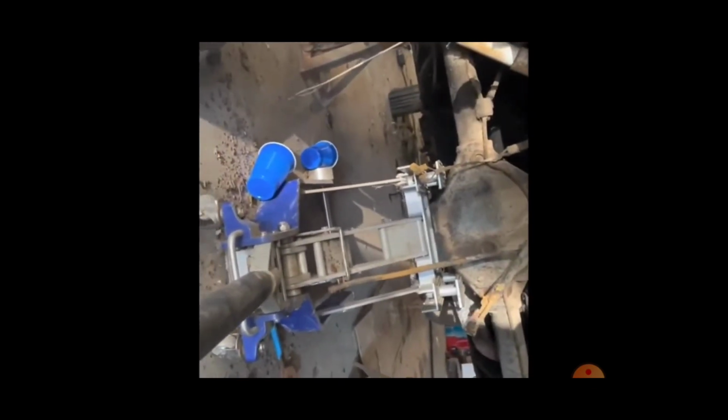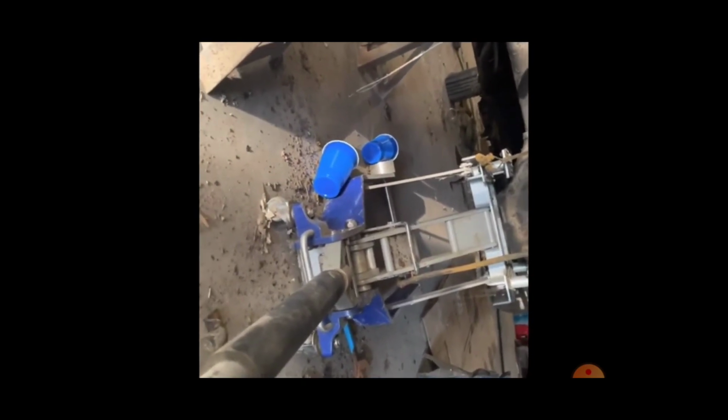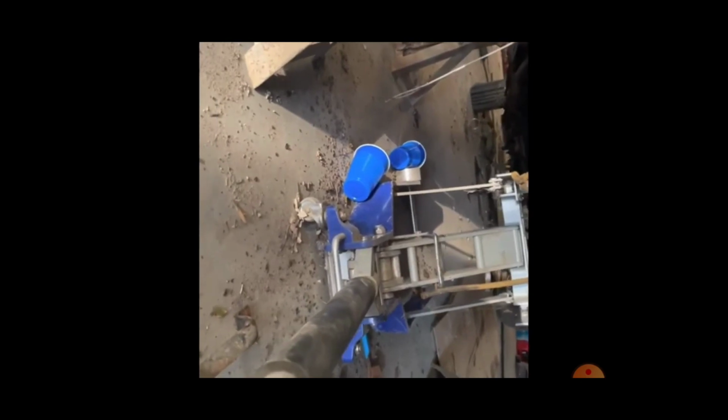If you look over here, right there, it's just leaking everywhere. We can't try to pump gas out of it. And I've come to the conclusion I'm probably gonna have to buy a new tank because it's just rusted out. And those lines, I'm gonna have to replace the lines, I guess. I think only the return line, but the other line I can't remember what it's called, I'm not gonna replace it. I'm just gonna put a piece of rubber on it. I'm just gonna switch to all the rubber lines.